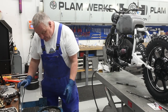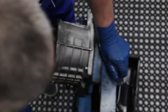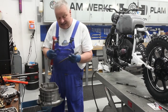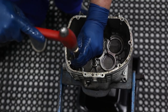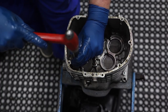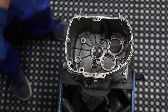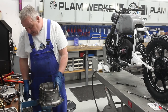We've got this pretty well all apart. The last thing is to knock out these bolts since they're a press fit. Now's a good time while everything's apart. I'm using a brass drift to make sure I don't mushroom the bolts at all — just tap them through with a pan below to catch them.